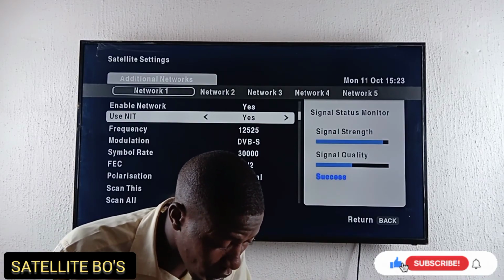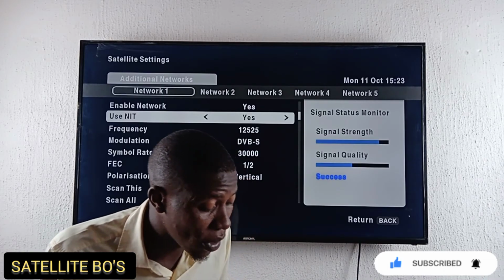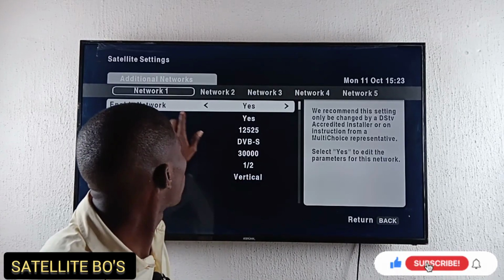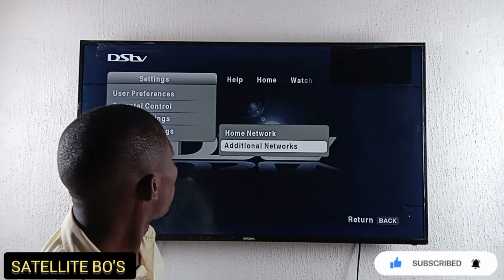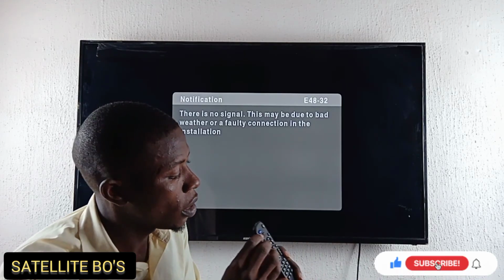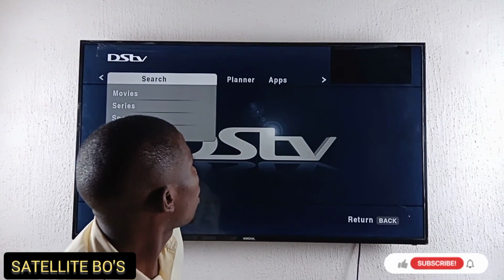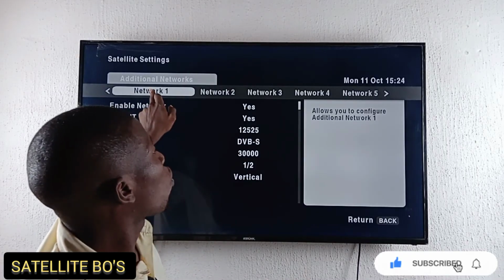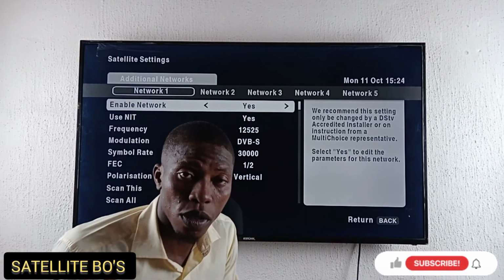All right, one, he said, couldn't get the network options on my DSTV Explorer. Explain. All right, so that means that you have not enabled your network. Let me just go over the process. You press your menu. This blue button is your menu button. Press it, menu, then go to satellites, then go to satellite settings, come to additional networks. Then you see network one, you have to come down here, then to enable network. Yes, all right. I think that should be where you're having your issues from.